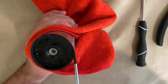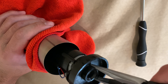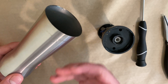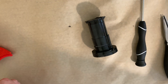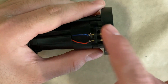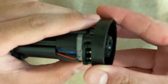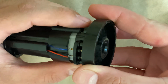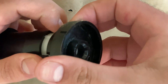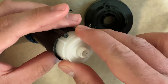If I hadn't done that it would have been a nightmare to remove this. Once you're done you can take a pair of pliers and just pull it and it'll come right out. As you can see the stainless steel has not even been damaged — always take your time, never rush. Now that it's been removed, put the stainless steel housing aside. Be very careful because there are two wires — one is your ground and the other is the positive. Tilt the piece towards the wires rather than away so they don't break, and the mechanism should come right out.